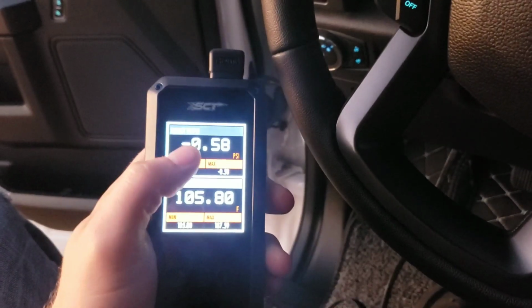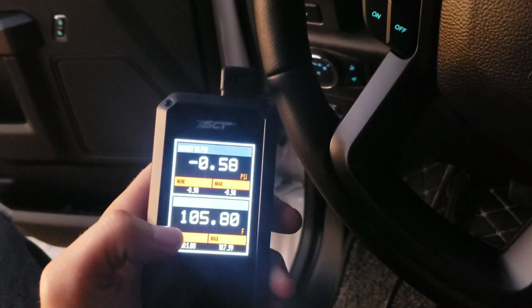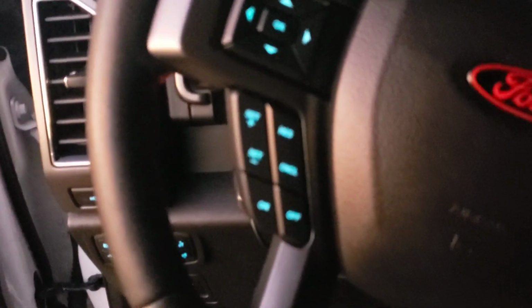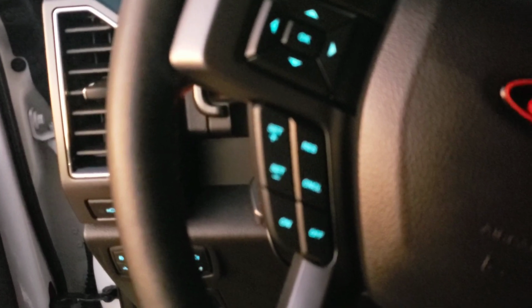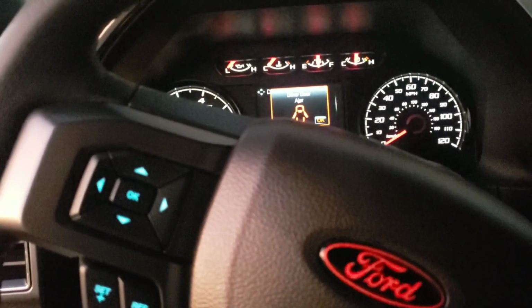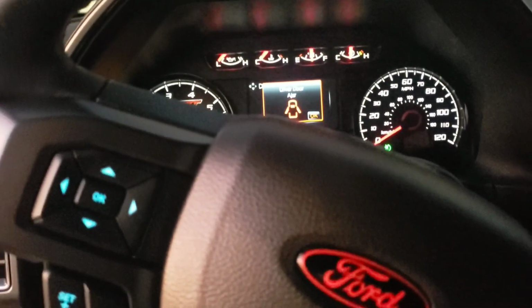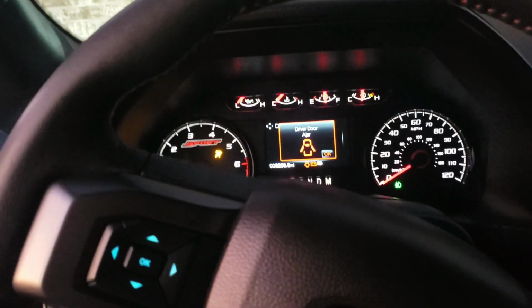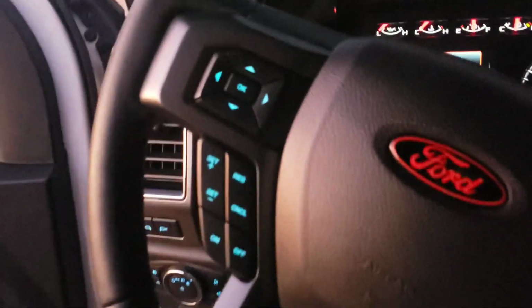But I do want to be able to see how much boost it produces and the intake air temperature, because I'm getting a closed box instead of an open one to try to help with the temperatures. I watched a video earlier where they tested an open box and a closed box, and the closed box stayed about 20 degrees cooler than the open. So I mean, that's the whole point of a cold air intake, is to keep the cooler temperatures. So I'm going with a closed box, but that will be in the next video.